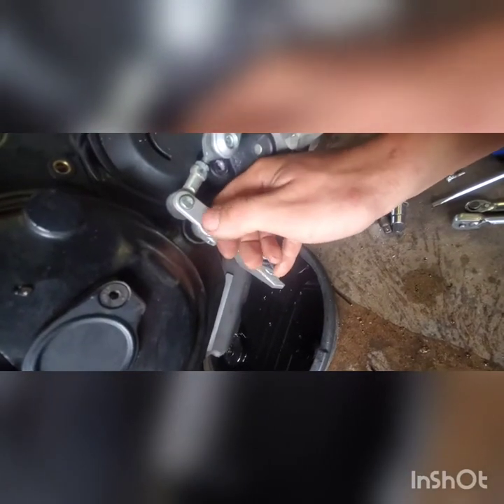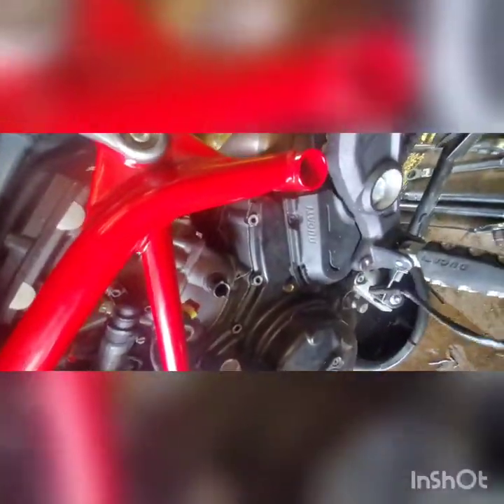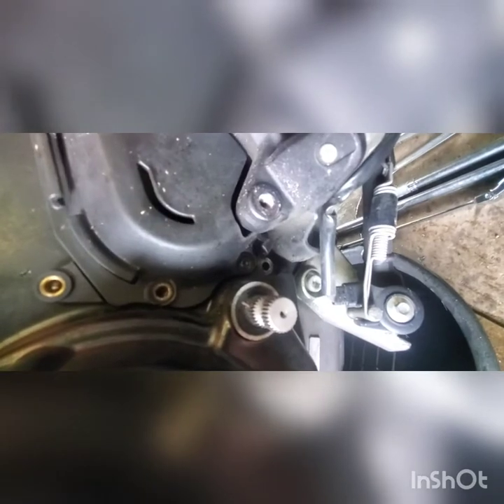Normally you'd want to scribe or use a permanent marker to mark the position and then pull it off. Sometimes it's pretty difficult to get off — you've got to get a flathead behind it for some leverage. After you remove that, you've got your kickstand wire routed through here. I already got the bolts out of that so wiggle it out. Your plug-in is right here and you can slide it off by pulling it forward — just pop your connector off and get it out of the way.